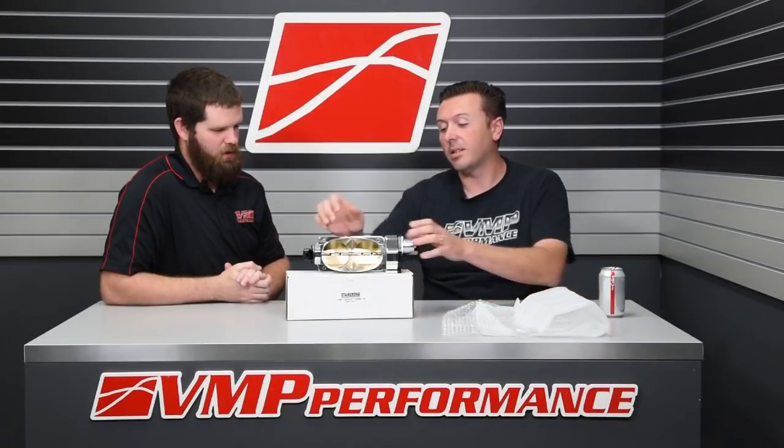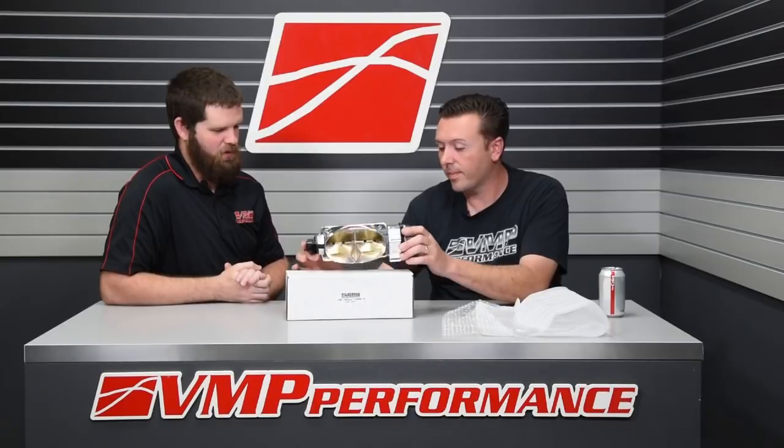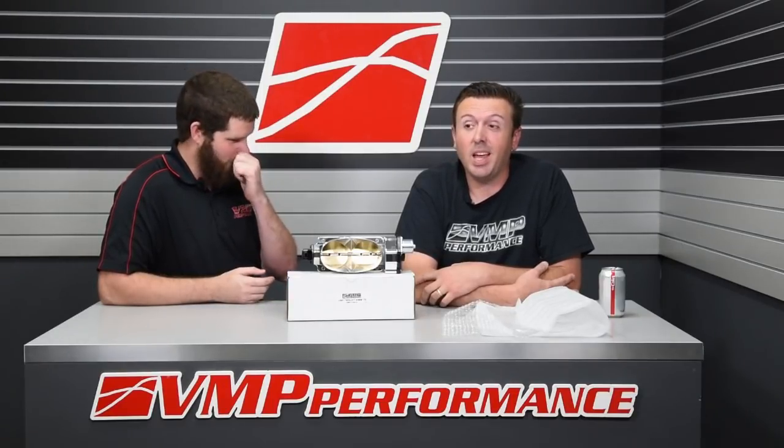Why do we keep making small twin blade throttle bodies? Small-ish. Because they're really tunable and drivable. And like Joe said, other tuners just don't have problems with them. You get into the weeds of this stuff, but at the end of the day, we get calls on occasion from people saying, oh, my Twin 67's not working. Are you sure it's not working? Get your tuner to send me a log of what you're referring to. And it's like, TPS is working and the throttle's moving properly. What issues are you having? Oh, it surges. Okay, well, get with your tuner. They're probably changing a lot more than they should be.